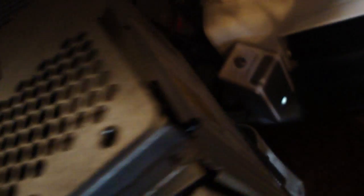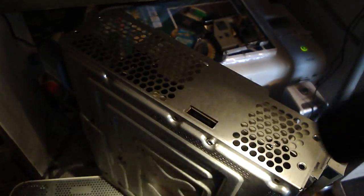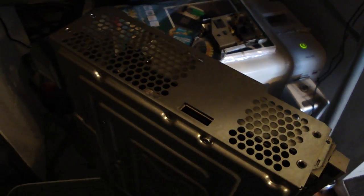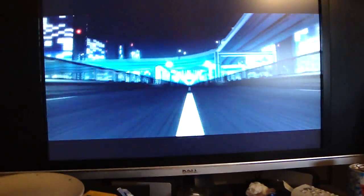One other thing to make sure: when you replace the screws on these heat sinks for the GPU and CPU, make sure you apply some thermal compound. Try your best to get as much of the old compound off the GPU and CPU as you can, without using any super abrasive cleaners. You can probably just use some regular rubbing alcohol and a Q-tip to get them clean, then apply enough thermal compound. A lot of people like to use Arctic Silver, but any thermal compound will work.